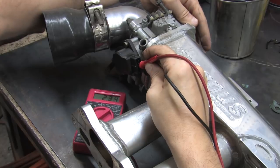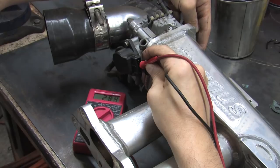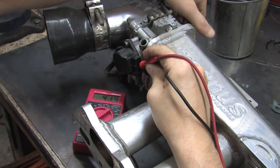There are no specifics for this value in the service manual, only an acceptable range of resistance. None of those values that are listed match what your car is looking for its idle value, so this is what worked for resistance on my GSX to achieve 0.63 volts at idle.